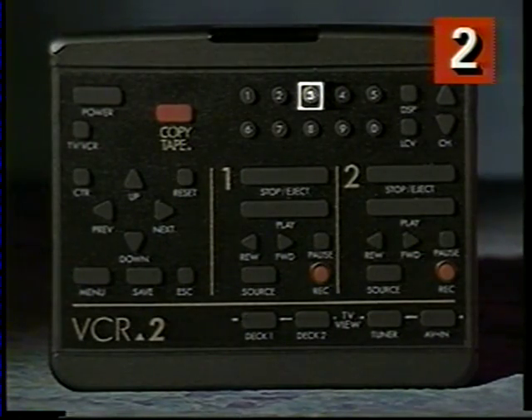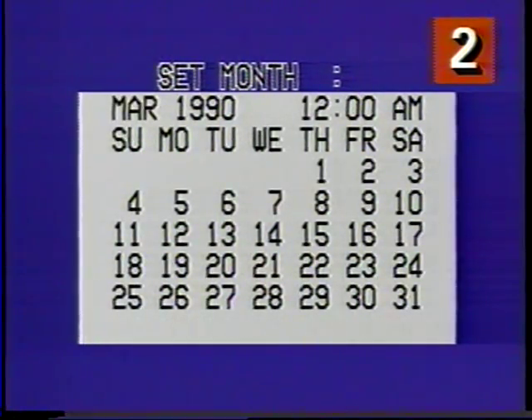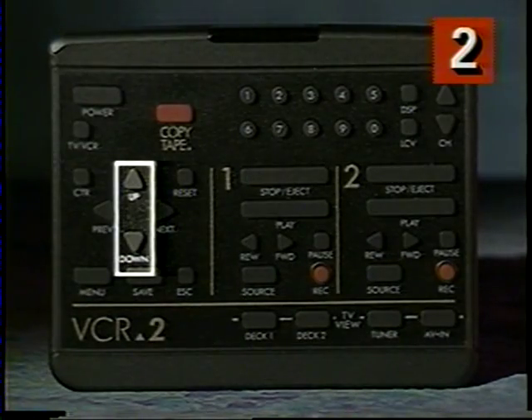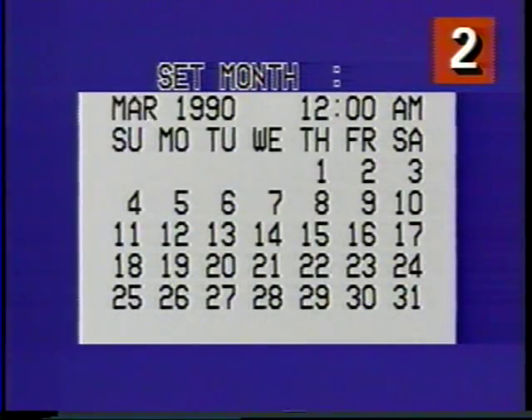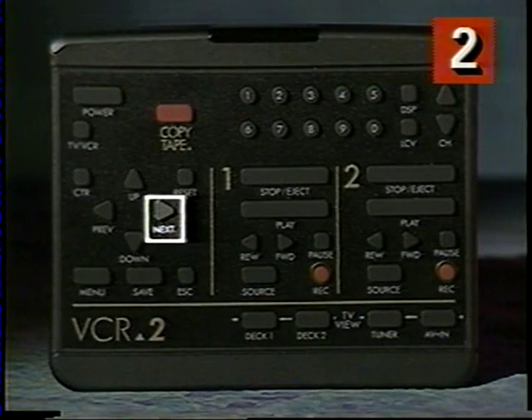It's pretty easy to find your way around, especially if you use those numeric buttons. See the line that says 'Set Date and Time'? That's the one I want, so I'll press 3. Now you'll see the calendar. The top line, 'Set Month', tells me what to do next. I punch in the month — 01 for January, 02 for February, 03 for March, and so on. Or I can use the up and down buttons to change the month. The month I pick shows up on the second line, and it's blinking so I can find it easily. When I've got it right, I press the next button on the left side of the remote control.